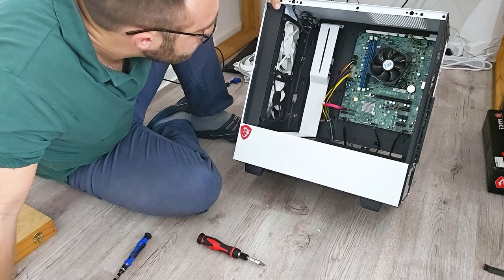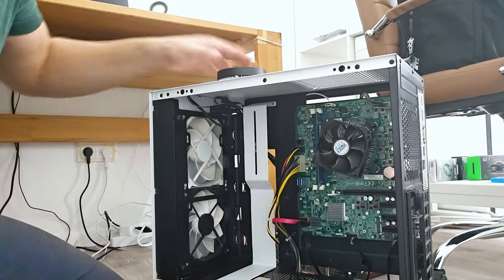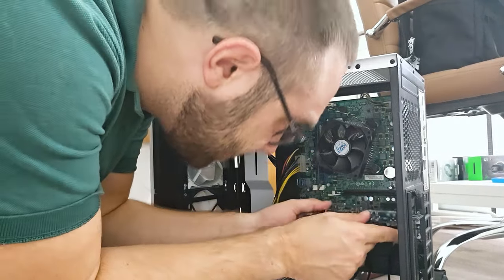Cable management - always on the last part. The drive is in, power supply's in, graphics card will be the last bit. Everything is in, we just need to connect the fans and the graphics card. We have a huge problem - I just realized we cannot connect this graphics card because it has this power connection and the power supply does not have it. So we can't connect the old graphics card to this one, so we go with the original one and be happy about it.